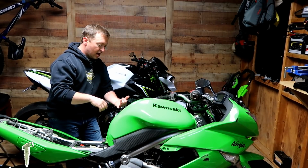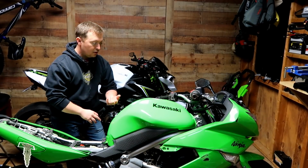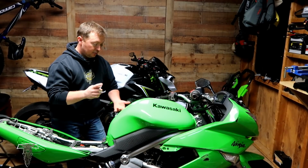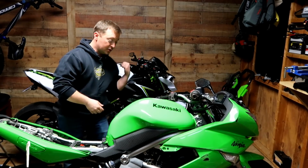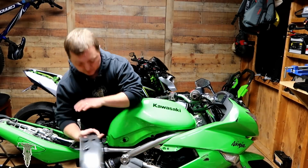And then we should have a vent hose underneath, fuel pump power, and then the float level harness. Fuel line, vent line, and the 2 electrical connectors. And that should be it. So very similar to this bike, but let's do it. That was easy.